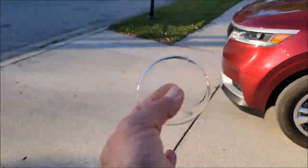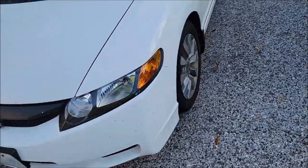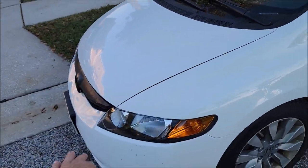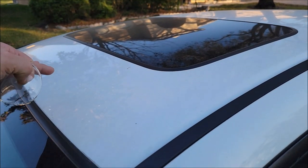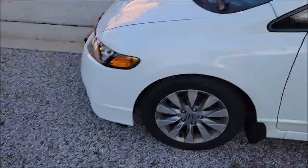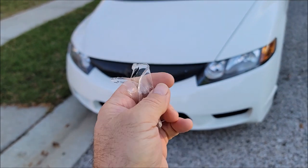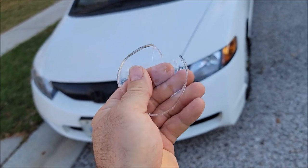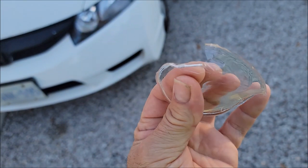So with all of that said, I have a 2010 Honda Civic that I'll be working on tomorrow. I will be doing the entire front end — both fenders, the hood, the front bumper, the mirror backs, and I might do the front of the sunroof just so you can see what the line looks like. You can't deny it — look how flexible and durable this is. It is going to protect everywhere you spray it, and it's very high build — essentially one coat diluted 50/50 gives you about six mils of thickness.